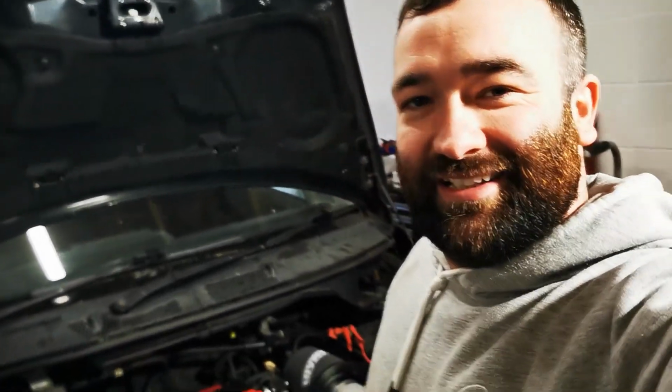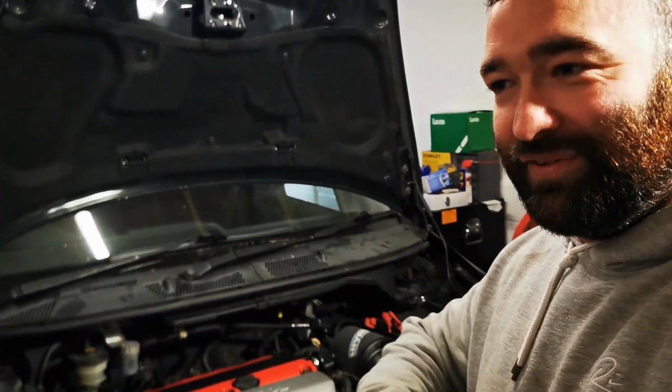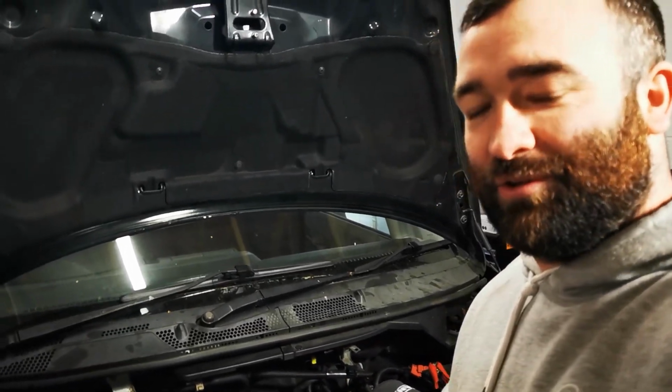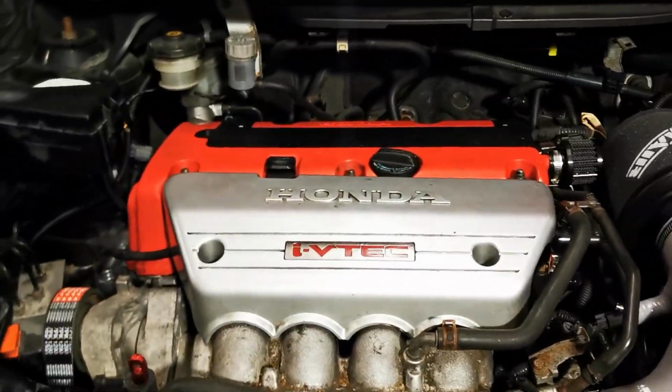But the next day, Liam persevered, and he found an ECU wire, the 12 volt feed for the ECU in the new loom that he'd got, was not quite pushed in on the connector. Pushed that in, fired straight up, which is a bit annoying, but it is done. There's a few little jobs, like the exhaust, which we're doing today, mate.